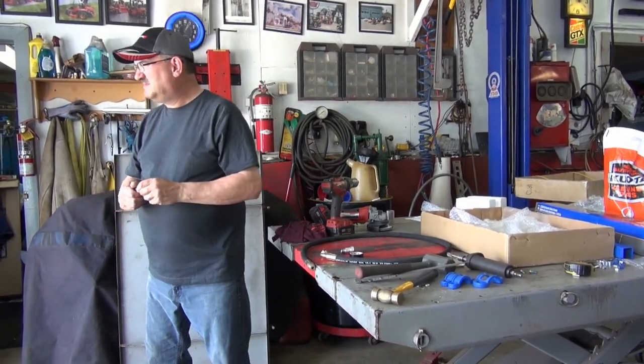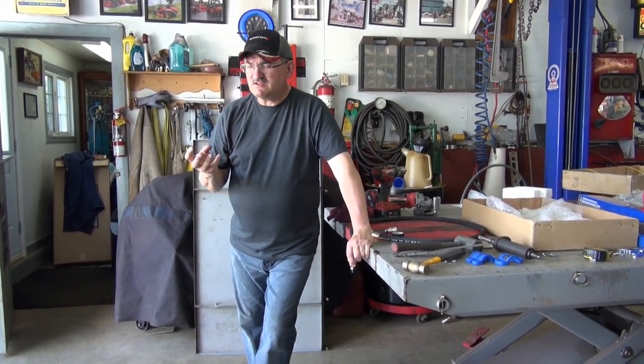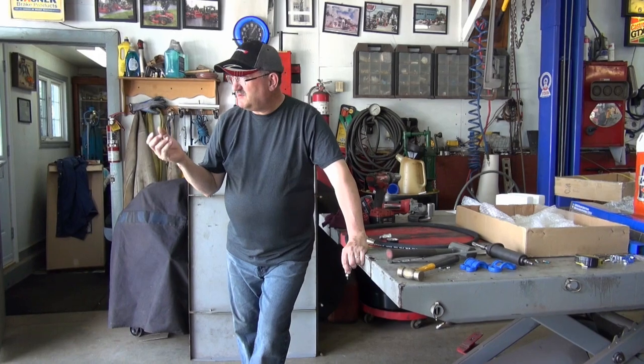We had a part missing off. They found a part under that truck, and they didn't know what it was. When they sent it to me, it looked like an insulator. And he said, I don't know what it is. I said, it looks like it's off a cab mount. And sure enough, that's what it was. So we have the bottom parts of the cab mounts, new bolts and everything ordered for that. It's not rusted, it's just that the rubber got all perished out.